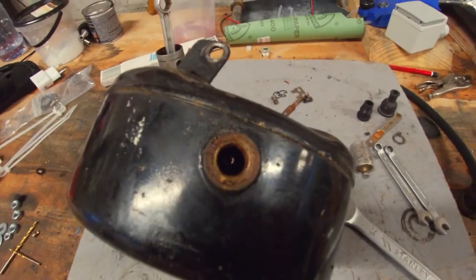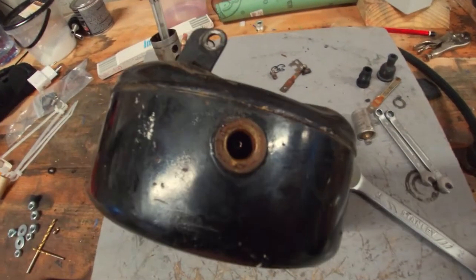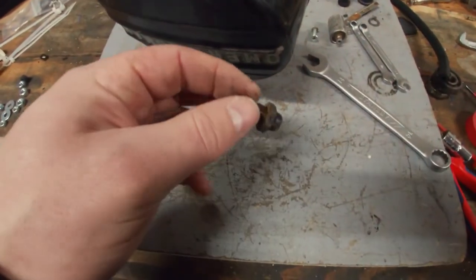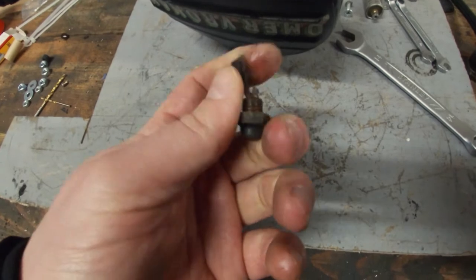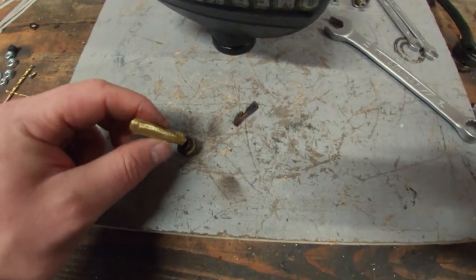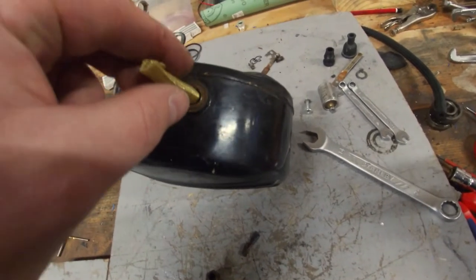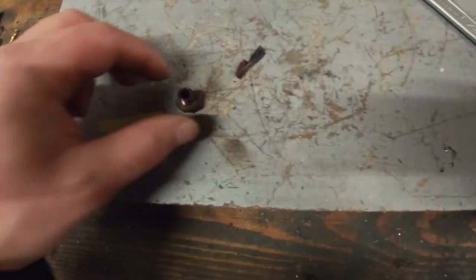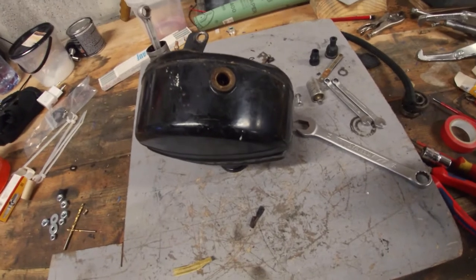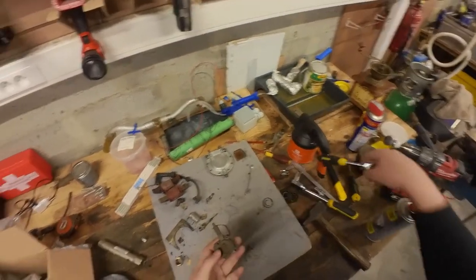We've got the fuel drain out. It's this plug, and this holds a little mesh filter that is actually in front of the fuel line, the fuel pickup, if you can see it here. So you should be able to pull this thing out, and we have a new one here. Just jam that in and the hollow part should just slide over the pickup tube like this. We're just going to clean out this nut and then reinstall everything, wash everything out with old fuel, and then add some new fuel. Let's also open this fuel pump so we can put it in the ultrasonic cleaner.